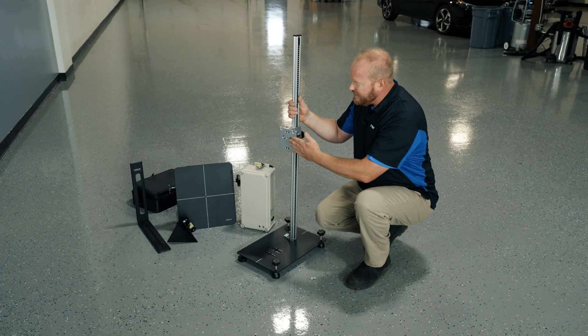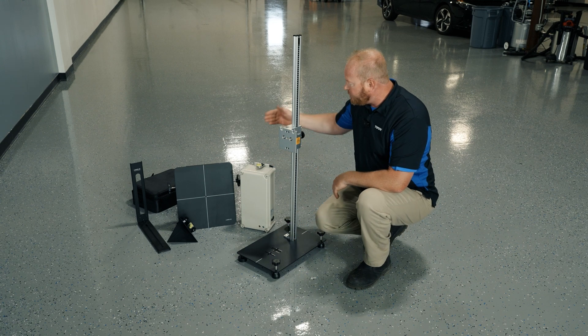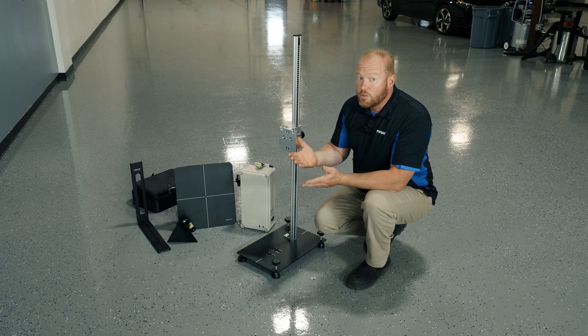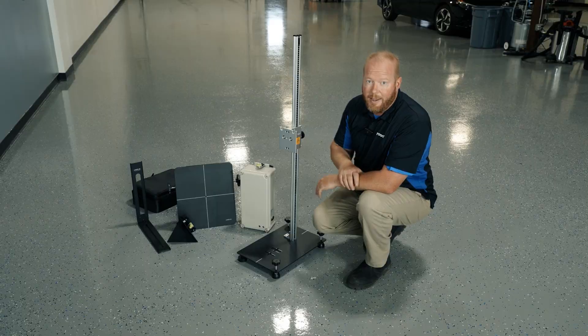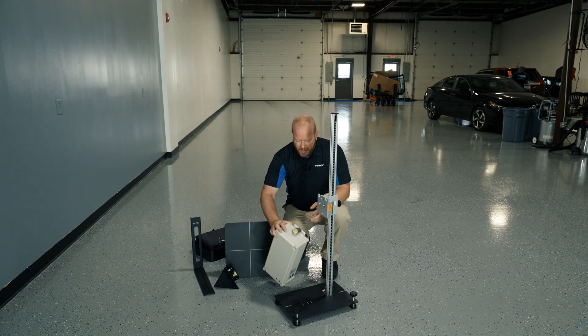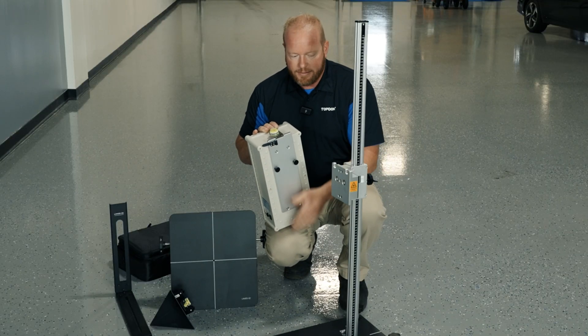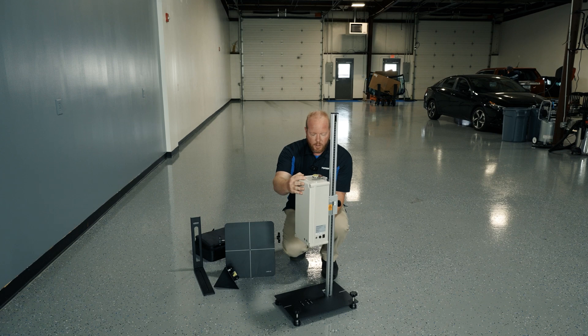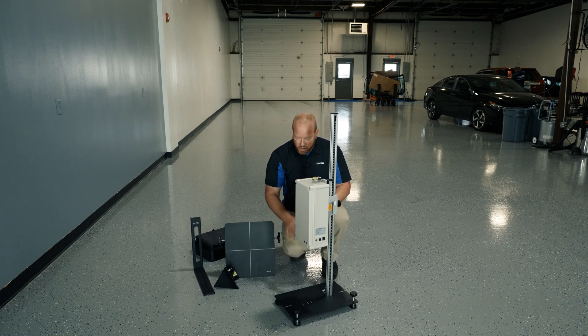On the base of this frame you can see three different measurements. Each of these targets is going to sit out differently from the plate, giving us the proper measurement from the front of each target to set it up on the car — and the tool gives us all those measurements right on the screen. Each target has its own bubble level. On the doppler, there's a bubble level on top and an indicator on the back for height. When mounted to the stand, we take that indicator out to get the height measurement, then use the bubble level to adjust the stand to make sure it's perfectly level and at the right height.